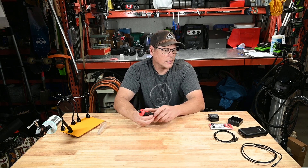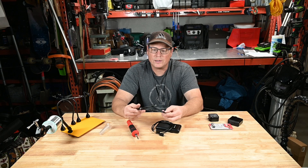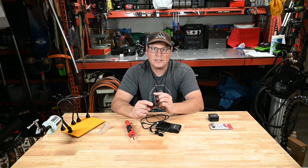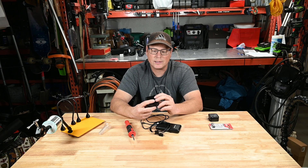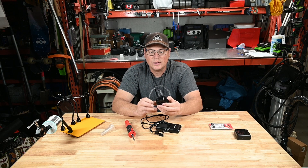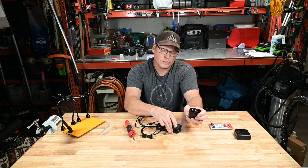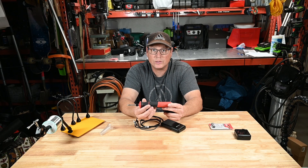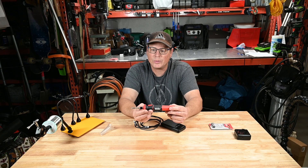It will run on a power pack or a charging port. It will not charge or run on a USB-C to USB-C cable. It doesn't work with PD chargers that have multi-volt capability, even if they have a 5 volt option. It only works with old-school USB-A charging ports on power adapters or power banks. Charging is 5 volts 2 amps, which is 10 watts, so it won't keep up with the 12 watt output.